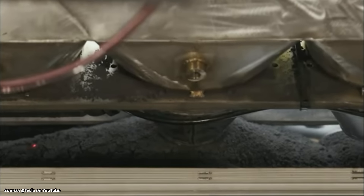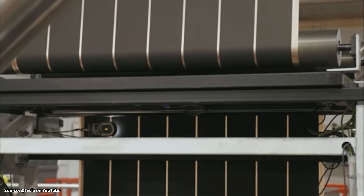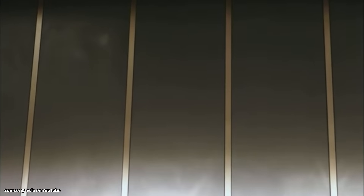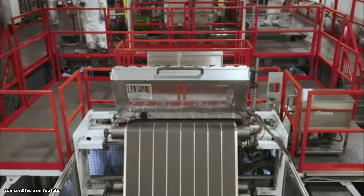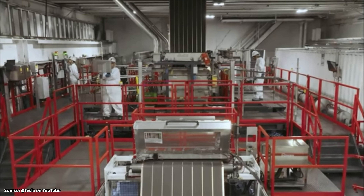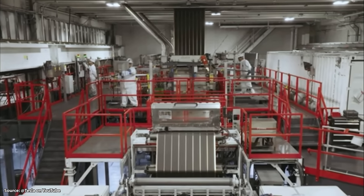As a reminder, pretty early on Tesla figured out how to manufacture the anode of the 4680 batteries with a dry process. That hasn't been quite as difficult as manufacturing the cathode side of the battery with a dry process. There's more than one reason for this, but one of the big reasons comes down to the fact that graphite is much softer than the powders they use for manufacturing cathodes.